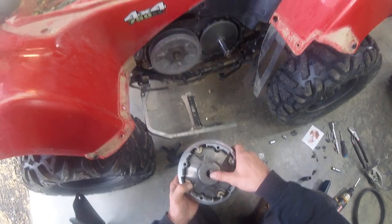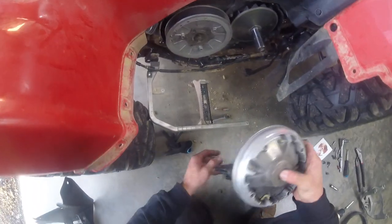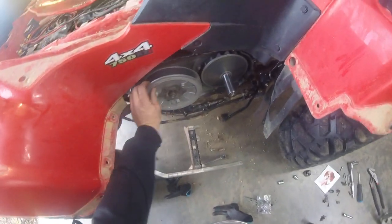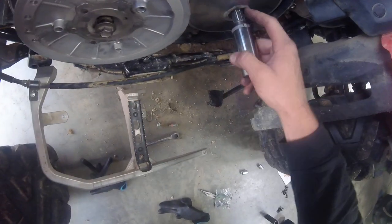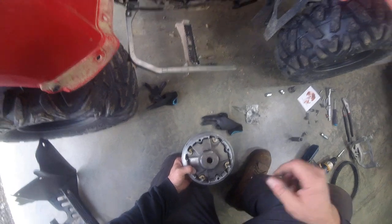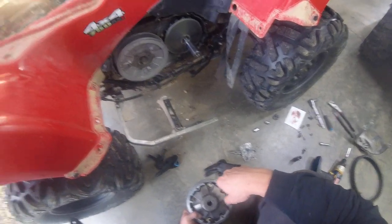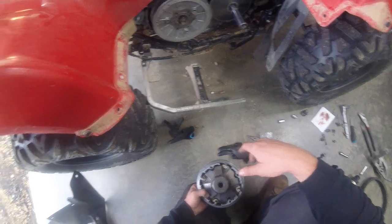It's not a big deal to take the transmission off one of these — the sheaves and the belt are pretty simple. We're going to clean this one up because it got sunk in mud last week and went through that factory CVT intake. We've already installed the 1.5 millimeter shims and we're going to put 16-gram rollers in it — I'll let you know how it does. I'll show you on the next video how to drill and weigh them. Appreciate you guys watching — if you haven't subscribed hit that subscribe button, share with your friends, hit the notification bell, and drop any comments below. God bless.